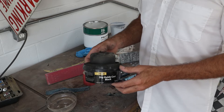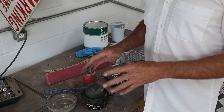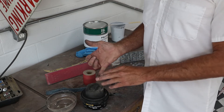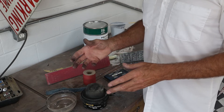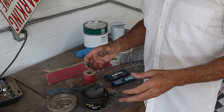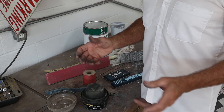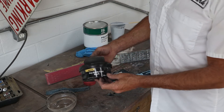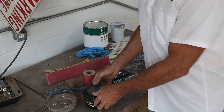It's a lifesaver and it will make your body panels come out so much straighter. It helps you find everything — low spots, sand scratches, you name it. It's quick and easy. No gun to clean, no rattle cans to deal with. If you've used rattle cans to guide coat, you've got to let it dry and then that paint clogs your sandpaper more than the primer — it's just a pain. I don't even know how long I've had this container; it's done a couple of cars already.